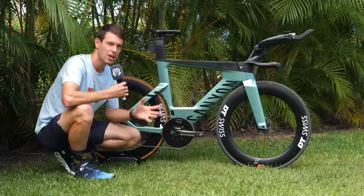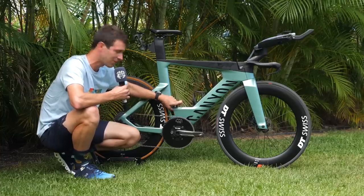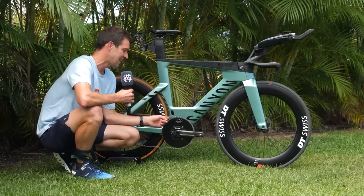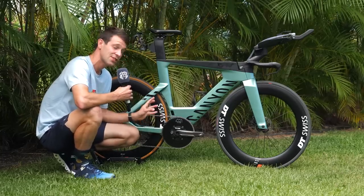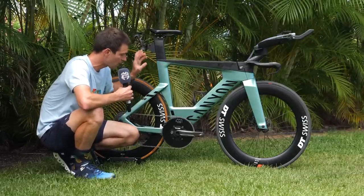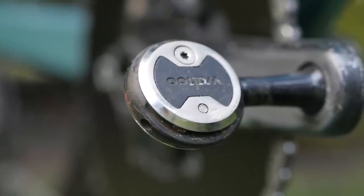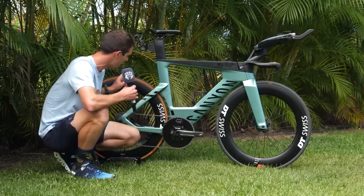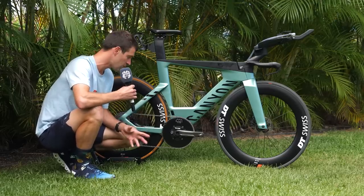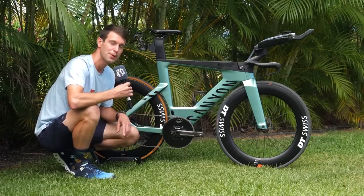Moving back through the bike, we've got some slight customizations for Kona. He's got a one-by setup. We've got a little cover for where the front mech would have gone — made by Canyon, fits in nicely. He's running a meaty 58-tooth chainring, one of the PCD classic one-by chainrings. Although he's running a Shimano Dura-Ace groupset, he's got the Quark crankset with a 170mm crank length, Quark power meter, and Wahoo pedals on the end. Paired with that 58-tooth setup, he's got an 11-28 cassette on the rear with a Dura-Ace rear mech. Coming down from that, we've got the Ceramic Speed OSPW oversized jockey wheels — basically they smooth out chain flow and reduce friction. The chain will be swapped out for race day.